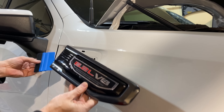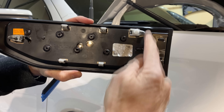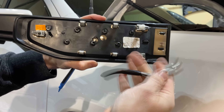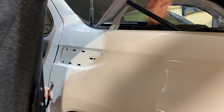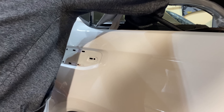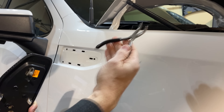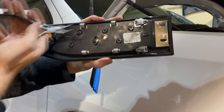I've already taken this off, but I did that for a good reason — I want you to see all the clips on the back and exactly how they connect. We've got one, two, three, four, five, six, seven clips. The nice thing about all of these: if you have some small angled pliers, you can reach in behind the shock and get in behind the back of this badge area. You might be able to see my fingers pushing through those holes. This gives you a little more reach when you have a tool like this, and all of them can be squeezed from above and below.